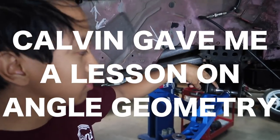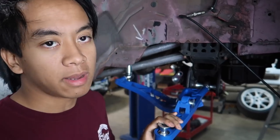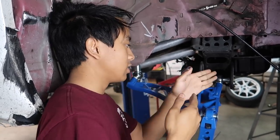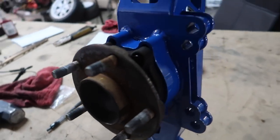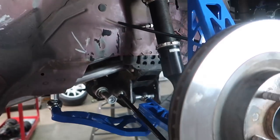The offset bushing — the shorter one was here to begin with and the longer one was here. We were debating about an offset spacer and how it would change the geometry. These are fixed length bushings. The next step is we've got to put this knuckle back on. Yesterday we put the rotor housing on once it was already on the car, and we discovered that it was much easier to assemble it while it was off.